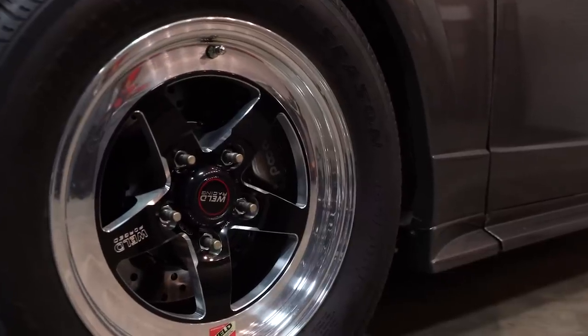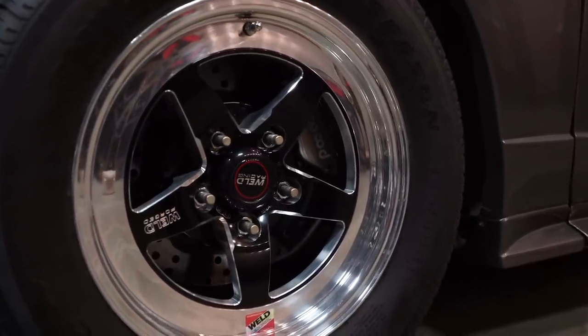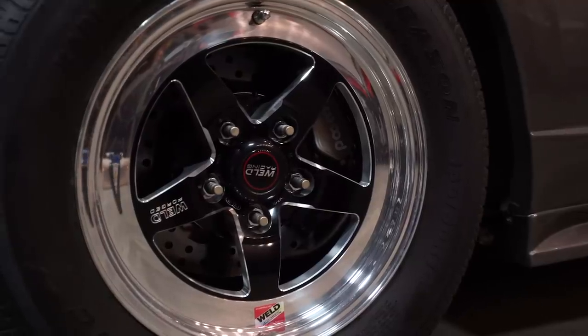These ones just came with a package. I typically go with Mickey Thompson SSs — that's like a 4.5 to 6-inch tire. Either way, it's pretty small on the front of a car. You call them pizza cutters when you're going down the track — it basically carves your way to go straight. If you have too fat of a tire in the front, the car will get a little crazy top end and shift in different directions you don't want it to go. You want it to go straight.